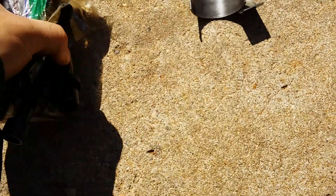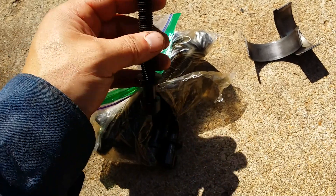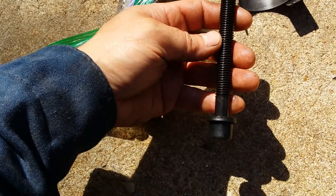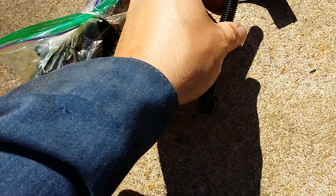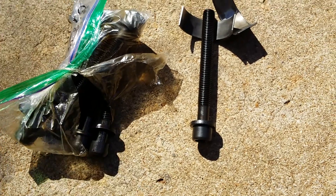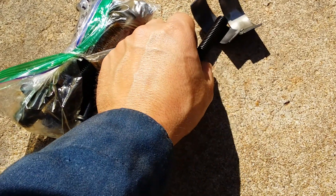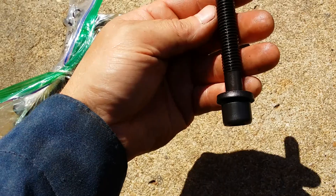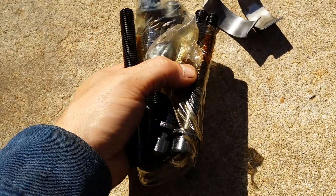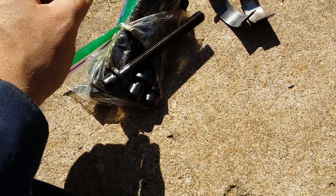These are the head bolts — again, these are stretch bolts. You must replace the head bolts any time you remove the head for a head gasket or internal motor work. I'll tell you why: I didn't replace them one time and I blew the head gasket — not bad, but enough where I was burning antifreeze and had to keep adding it. I ended up taking the head back out, replacing the head gasket, and putting in brand new head bolts. Again, stretch bolts — one time use, do not reuse your old ones. That's about it. Thanks for watching, leave me a comment, and don't forget to subscribe.